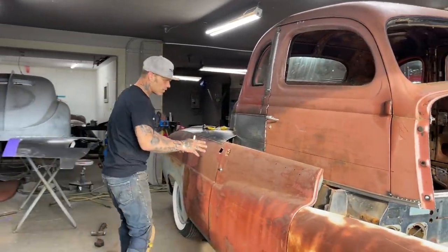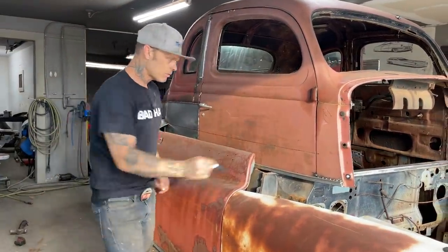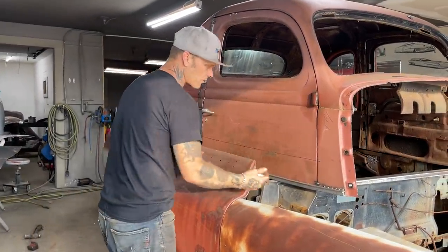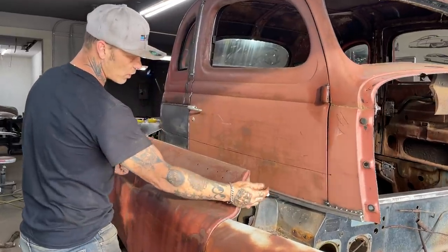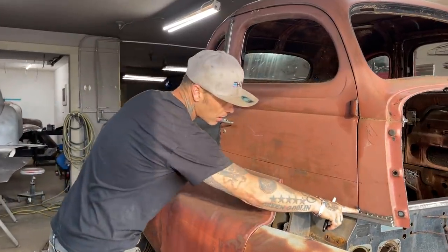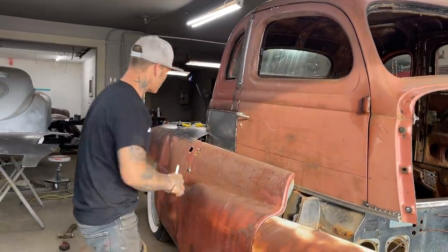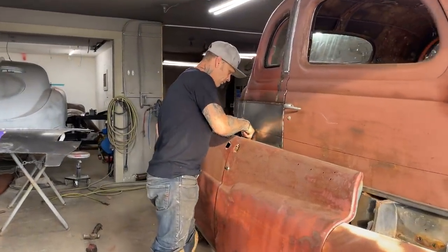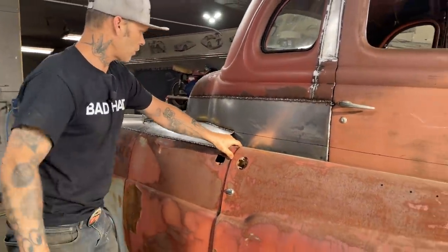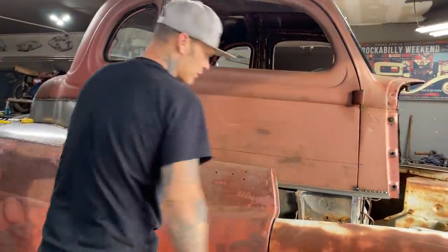But right now, what I want to do is get this door locked shut. This door is not locked shut yet. I have to cut the square tubing off. Make sure that the door could open if it had to on the bottom, because it's as long as the square tubing, could be rubbing on something. I have to cut this tack off, cut that tack off, re-tack it up here and re-tack it up here. I want to put a little piece on here to cap this over here to go down to the square tubing there. And then I'm going to proceed to shut the door, and I'll make this piece, and then I'll make another piece. And then maybe we can shove our hood on, see what happens.